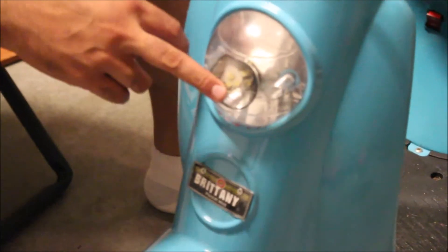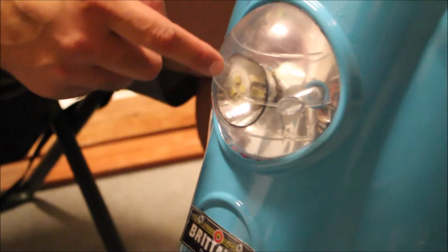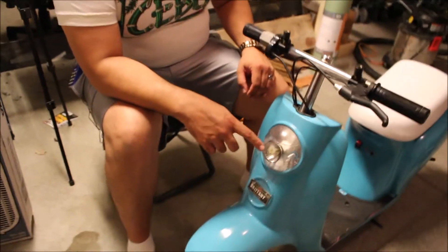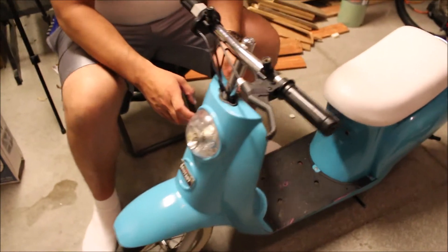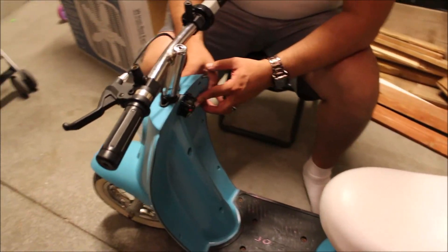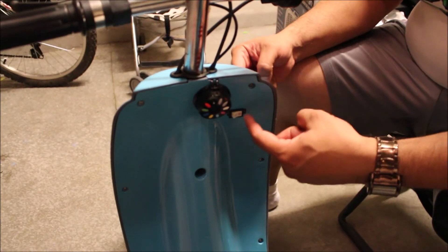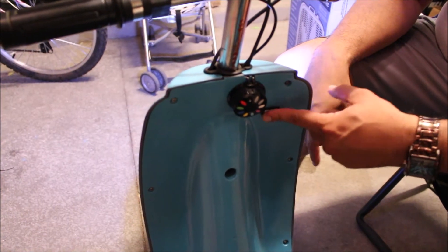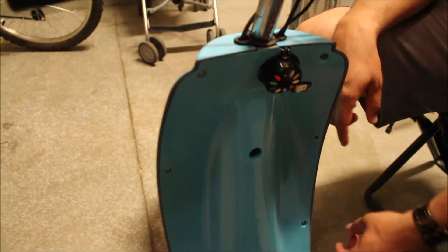The scooter has a bright LED light — 15 LEDs — running off 12-volt batteries. The problem is it's actually melting the plastic ring of the reflector. The wires run from there down the side and connect to the switch. We did have a push switch, but as mentioned, there wasn't enough space between the two parts, so using a standard on/off switch worked a lot better.